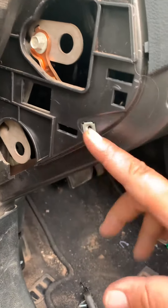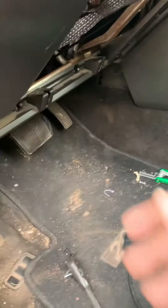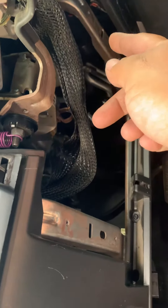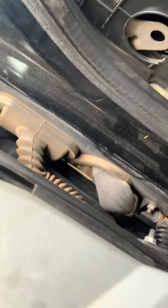There's going to be a little screw right here, you'll take that off and it'll expose down here. Then you'll have a little metal bracket that'll go from this side to that side. Four bolts, all torx 20 — take those off. That'll come out, and then right above underneath the steering wheel there'll be a place for three bolts.